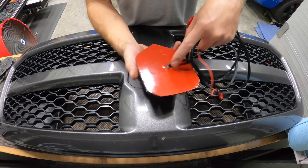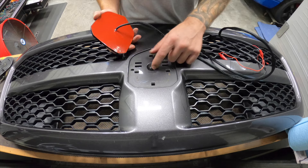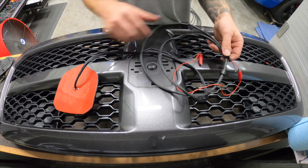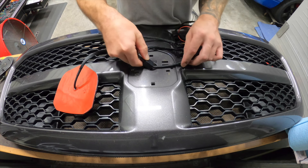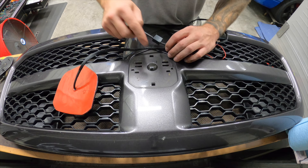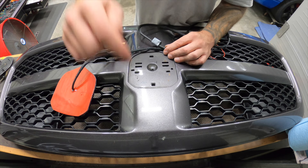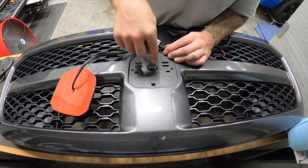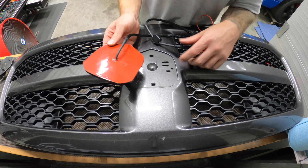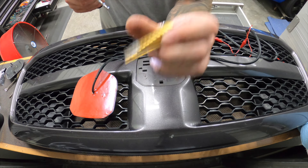You're going to notice there's a wire that has to come out of this new emblem, and you can't really pass it through any of this existing area. There is, however, this large circle here, and we also have to pass through our entire harness with its rather large box. So we pretty much have to drill out this exact circle. I'm going to use a step drill bit — I'll link one in the description below — and I'll start with a regular drill bit just to drill the center before transitioning into the step bit.